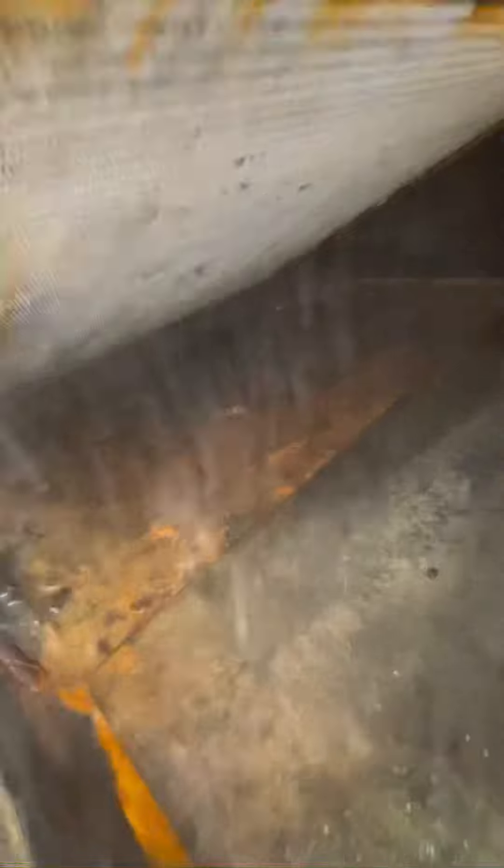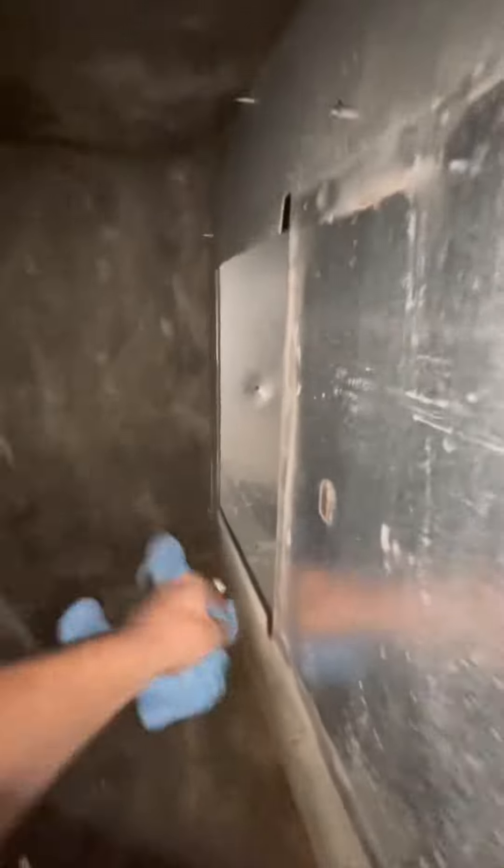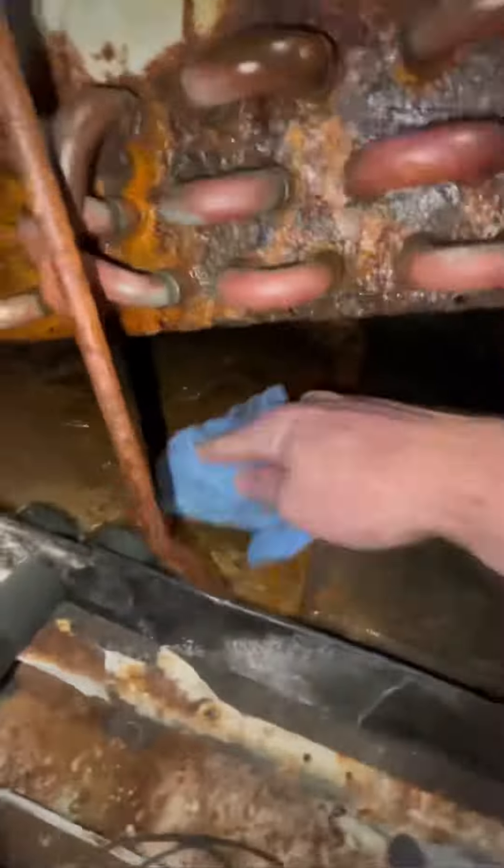The video was super long so I took the motor out and sanitized the whole entire cabinet. You can see how much gunk is inside that pan and how bad that coil is getting — starting to corrode out. It's over 10 years, so I try to be as delicate as I possibly can with everything. Even though this cabinet really did need a good cleaning, I just wiped everything out the best I could without destroying it, and then cleaned the pan out.